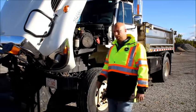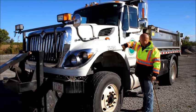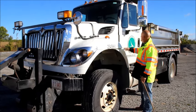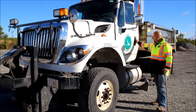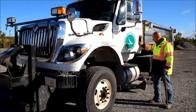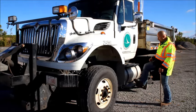At this point, I'm now going to close the hood of the truck. I'm going to latch my strap on this side and ask the examiner to latch the other side for me. Check my mirror — make sure it's securely mounted, not cracked, bent, or broken. I'm also going to check my door to make sure it opens and closes freely and that my hinges are securely mounted. From there, I'm going to check my steps getting into the truck to make sure they're securely mounted, not cracked, bent, or broken, and that they will hold my weight.